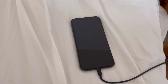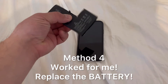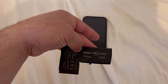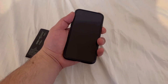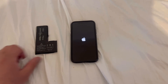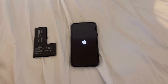Still no joy. Method four worked for me. If you've got a reoccurring problem just like mine and your battery is not charging or not holding charge, then you've got a battery issue — that's why it's boot looping. Especially if you've got a replacement battery and it's a copy, or if you haven't used your phone for a long time, the battery will most likely malfunction just like a faulty battery. So what I've done is replaced the battery.